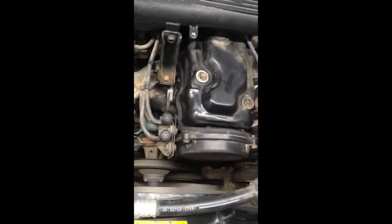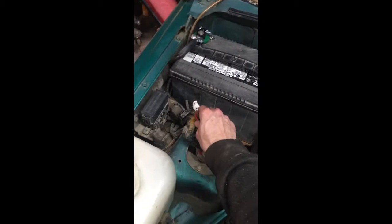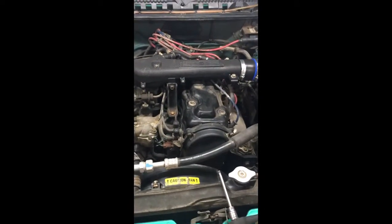We're good now. You can see that bore in the middle of the markings on the timing cover — we should be all good now, at around 8 to 10 degrees before top dead center. It sounds a lot better too. So that's pretty much it guys — you just point the light at it, once you've got your bolt loosened you advance or retard the timing, put that check connector in there, and then you can go ahead and take it out when done.